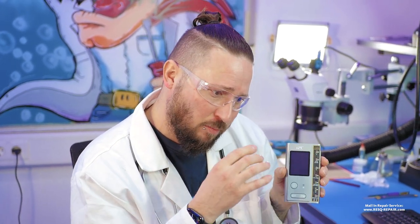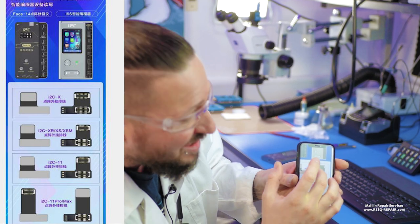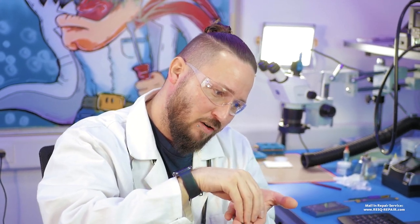So we talked a lot about this — why isn't it possible to make a tag on flex? A tag on flex which we connect to the dot FPC and then to the logic board, and on the tag on flex we would have the new IC and the deactivation for the old IC in the dot. That was my thinking. And now the revolution has started — after the New Year holiday, new manufacturers and new programmers have arrived, and it is now possible to repair the Face ID dot projector without soldering anything, without taking off the chip, without doing anything.